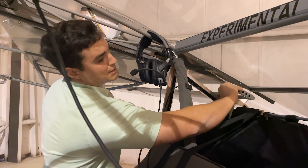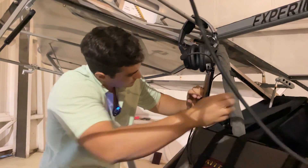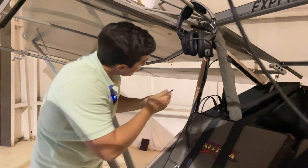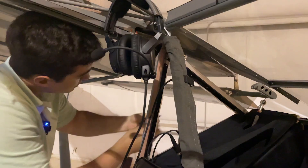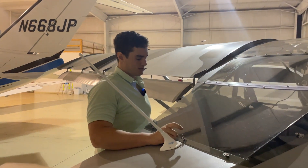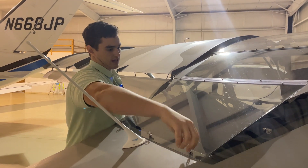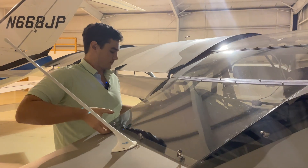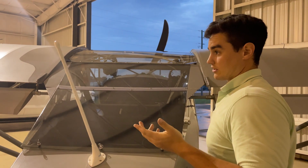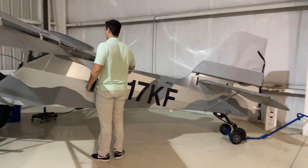I totally forgot — we have to take the turtle deck off, and that's going to suck. It's not only not fun to take off but it's also not fun to put back on. Now that the flaperons are undone we go for the turtle deck. There are a whole bunch of screws in here. I actually bought these — they don't come with the kit as far as I can remember. These are winged cam lock studs and they just make it easier to pull this turtle deck off.